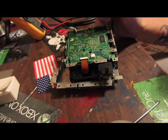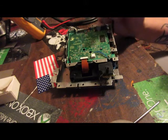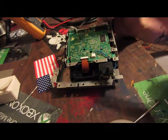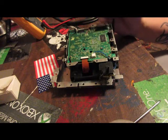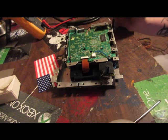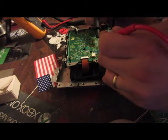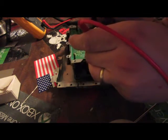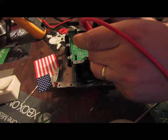The pot is going to be set anywhere between 150 and 600 ohms. Once you get to 150, it won't go any lower, because there's actually a fixed resistor set to 150 ohms, and then there's this potentiometer which you can tune. Let's get the test leads in there — we are sitting at 406 ohms.